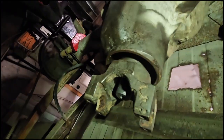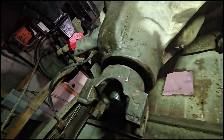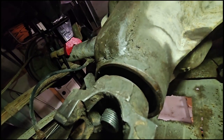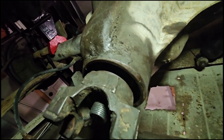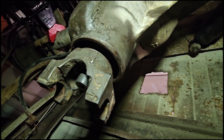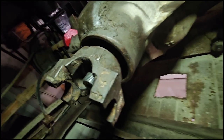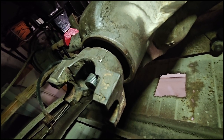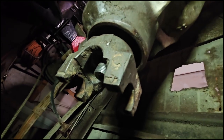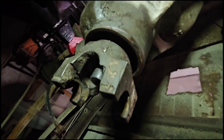All right, so I used the impact wrench, tightened it all the way in. Trying to use this headlight. Made sure that it's all the way down. So it's all the way in, and it was too tight. I could barely move it with my hand. I know that's not gonna work, so I'm gonna pull it, but I'm close, I believe. One more shim on this side of the bearing, and I'm hopeful that that's gonna put me within range. So that's what I'm gonna do. I'm gonna get my puller, take this off again, and hopefully just do this one more time.